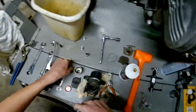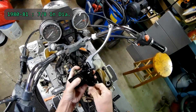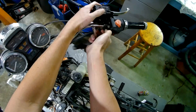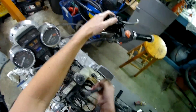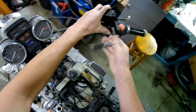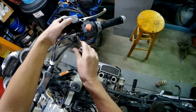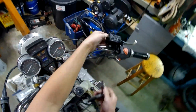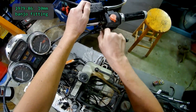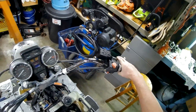These are 7/8 bars I believe. The main thing you want to do is make sure you check the size of your bar to make sure the diameter is correct, or else you won't have the right clamp force and the brakes are gonna slide all over the place. The other thing you want to make sure is that you've got the right size brake line.